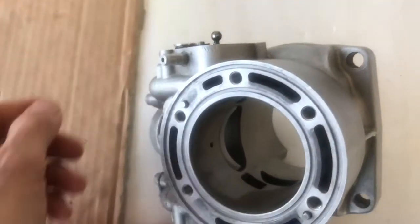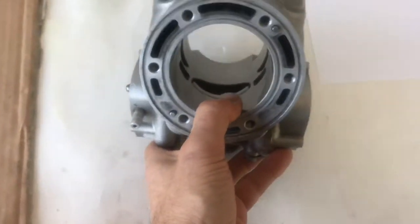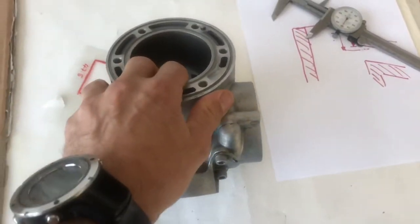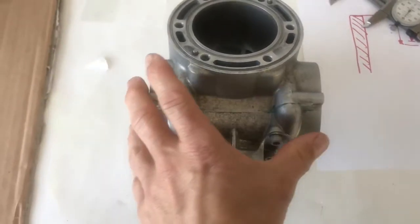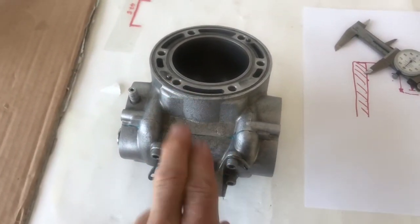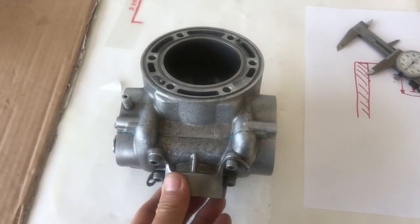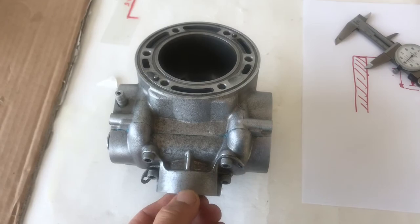It's going to be a bit fiddly, but it's trial and error and you'll get it done. Basically, that is how you set your power valve — very simple. Set your Z dimension and that's one less thing to worry about. Watch the next video and we'll be looking at setting the X dimension of the cylinder and piston as we put it back together. You have done it.